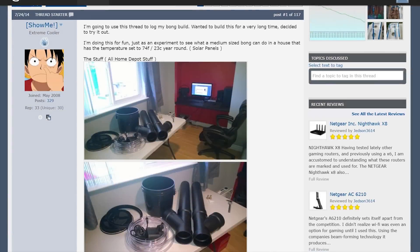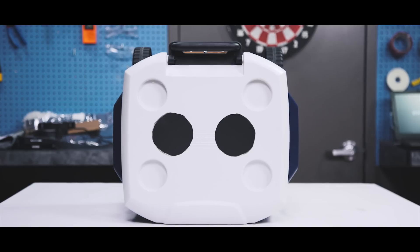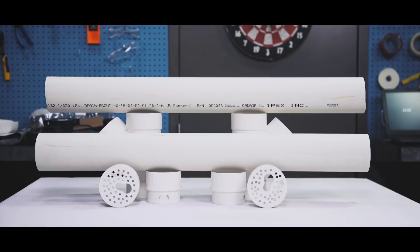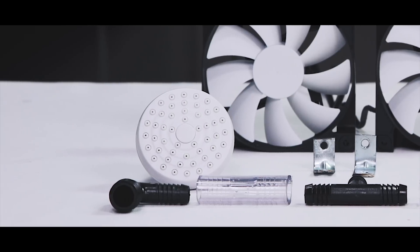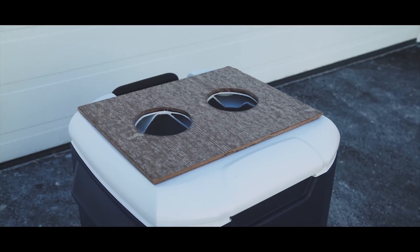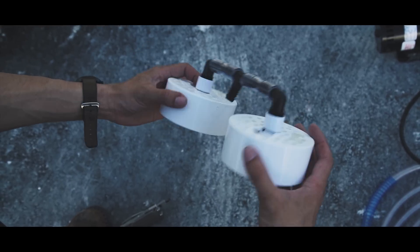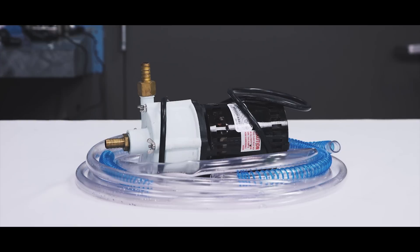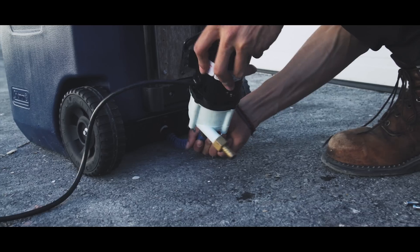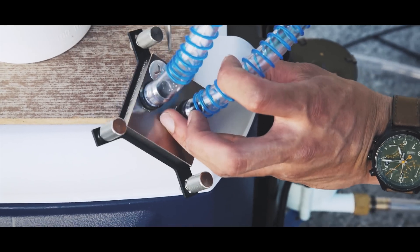Daris will be assisting me since I'll be in another country by the time this is being filmed. Here's what you'll need — we took a lot of cues from this awesome build log over on overclock.net. Four inch diameter PVC piping, PVC joiners, two 120 millimeter fans with a power adapter, as many shower heads as you will have cooling towers, some wood, a PVC Y — one per tower — a powerful pump to get water to the top of the shower heads, half inch clear flexible tubing, some miscellaneous five-eighths inch PVC fittings to join our tubing runs together, and a normal CPU water block.